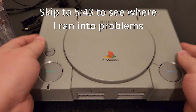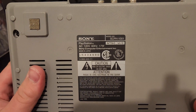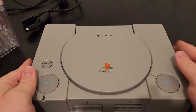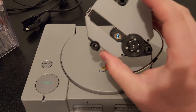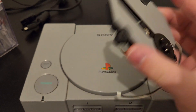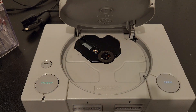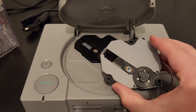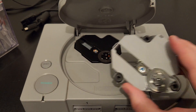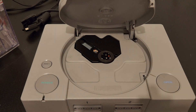Hey everyone, I'm making a video on how to replace the disk drive on this old SCPH-1001 model. This is the one that has the composite video out. To get this fixed, all you have to do is buy one of the late model PS1 disk drive assemblies. This is just a refined version of the original one. The original used plastic on plastic for the rail that moves the laser back and forth — it wears out over time. With this one you can swap it in really easy. Let's get it taken apart.